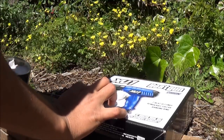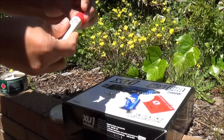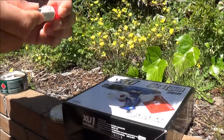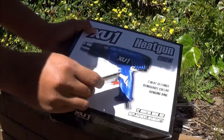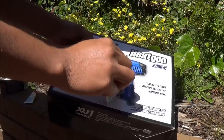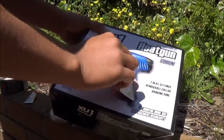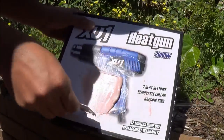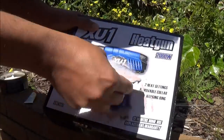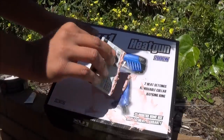Put it onto a clean piece of cardboard — you can use whatever you want. Then squeeze some of the resin in. Don't use too much because it will harden up quickly and start cracking once it's dry. The next step is to get a good mix — you really want to incorporate all the red paste into the white paste to make it look pinkish. Otherwise it won't dry up properly and will create air bubbles. There's your bog done. We call it bog, but the proper name is car filler. Let's go to the car.